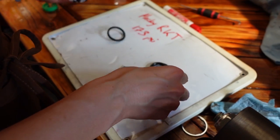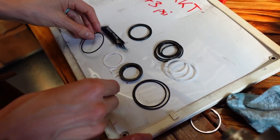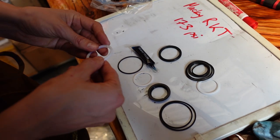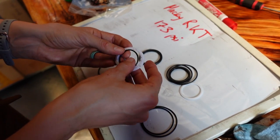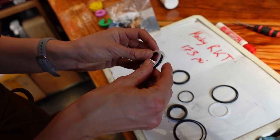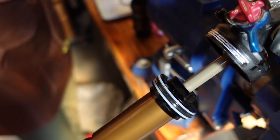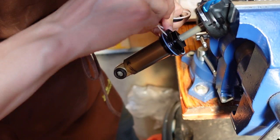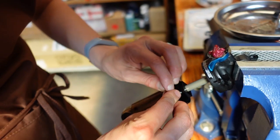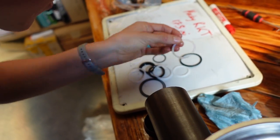There are so many different things in the rebuild kit, but I don't think you do all of them. You want these two seal head pieces, and then there's one that's an O-ring size that fits in between those two. This is an O-ring, and this is something else. So that goes in between them like this. First we've got to get these off — that one's going to have to stretch, and you can use a pokey tool, just be really careful. I think I can get it without. See which one seems like it has oil on the outside.